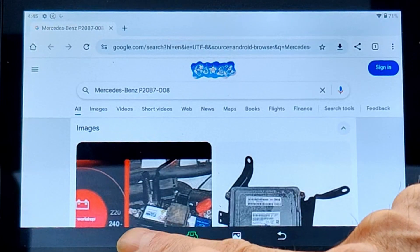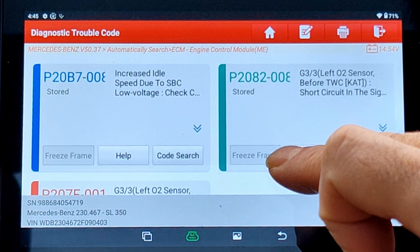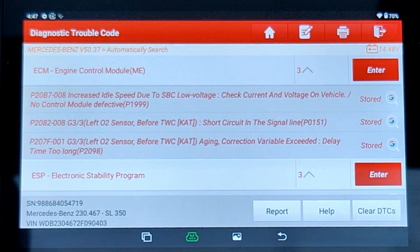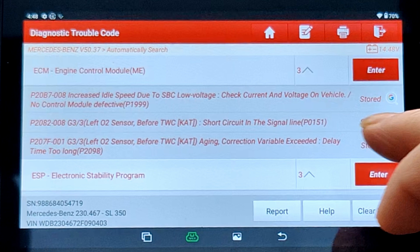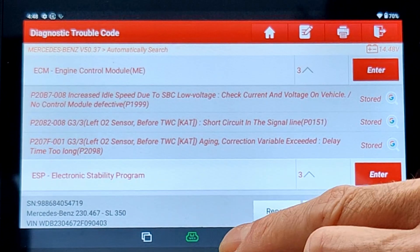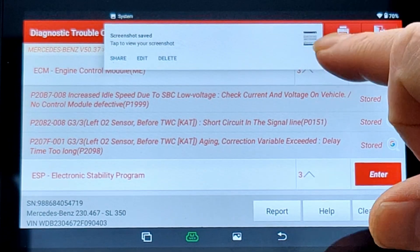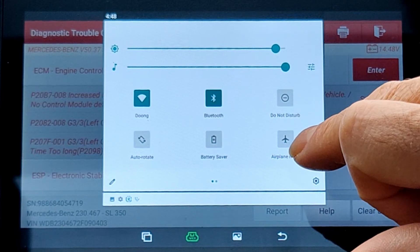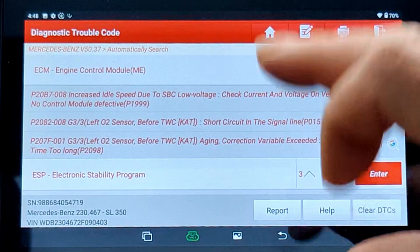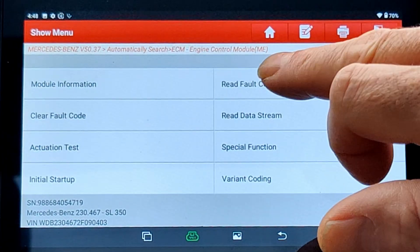You can press this little button and switch like a tablet between the screens. Going back to the error codes - it's talking about a left oxygen sensor. I want this information. I've gone back to the main page from the first scan. One of the things you can do is go down to the little picture icon - you press that and it will do a screenshot, which is nice. Also, if you slide down from the top you can actually cast the screen as well. So if you want to send it to somebody in the workshop or your professional garage, you can do a screencast. I'm going to take a couple of screenshots because I want to know the info before I start clearing the codes.